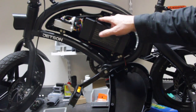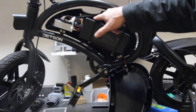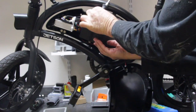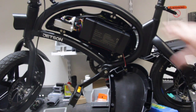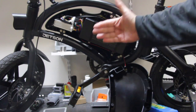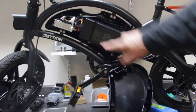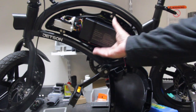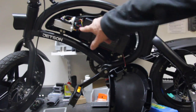We've written down our measurements. Now there are two Phillips head or cross-point screws at the top of the battery clamp — let's loosen those. Now the top two screws are loosened and we want to get the bottom two. One word of caution: when you loosen the final screw, the battery is going to want to fall out. We still have to disconnect the battery from the controller and from the charging port, so as we loosen this, we want to make sure we catch that battery before it falls and don't damage these wire connectors.